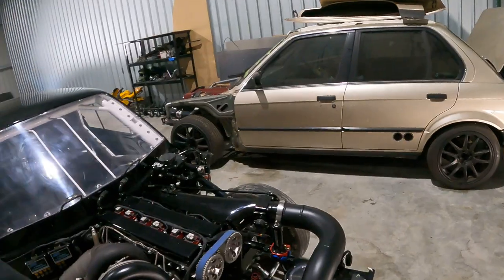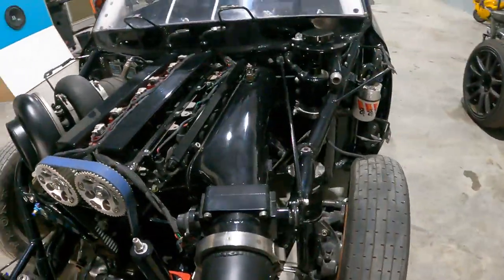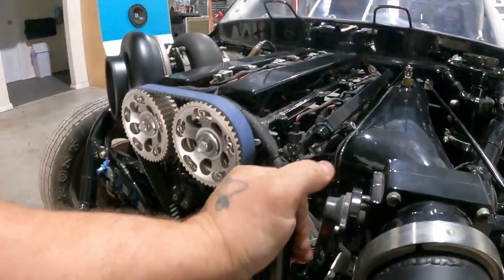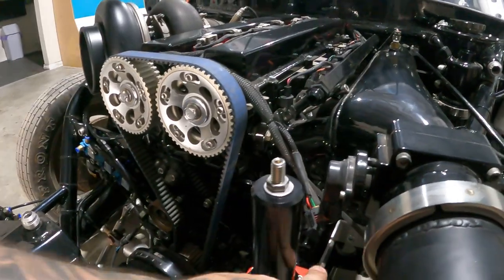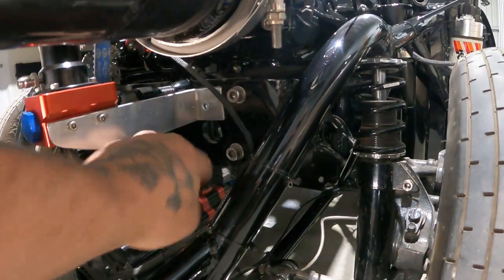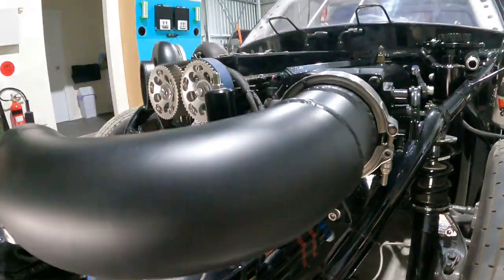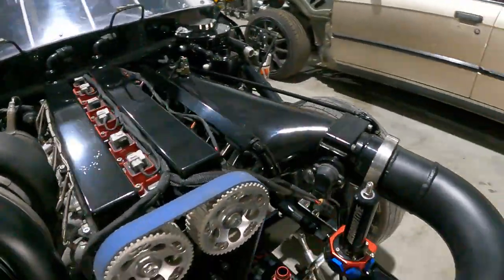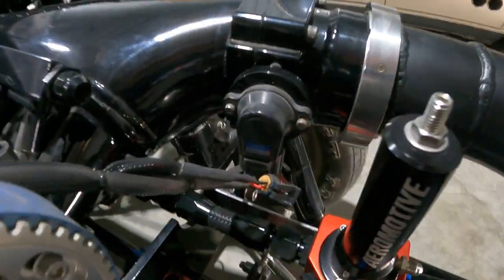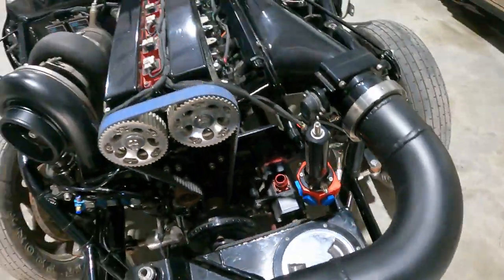Well, that is awesome. Have a look, we've got it all mounted up. All right, I'll paint the bracket up black a bit later, but all sweet, it comes up solid as. So 3mm alloy, tapped M8 going into the motor plate, and obviously just smoothed out the bracket, so it's nice there. That has come up real nice, and as you can see, it's just a tiny little bit of hose there.